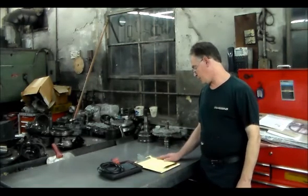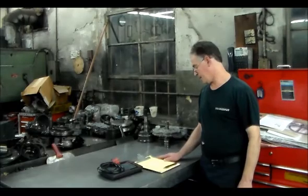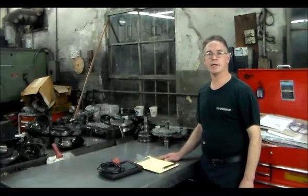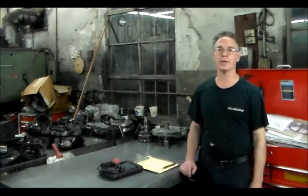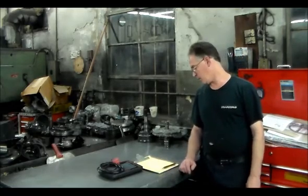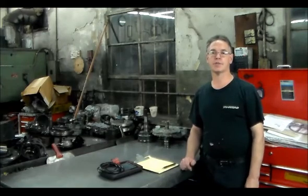Today I have a 2008 Toyota Tundra. The transmission is the six-speed Toyota transmission called the AB60F, and it's also a four-wheel drive. I'm getting code P0983, shift solenoid D, circuit high.